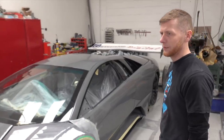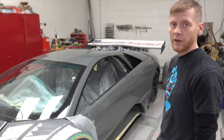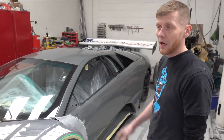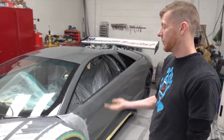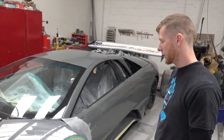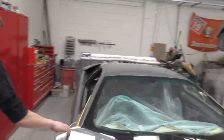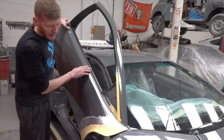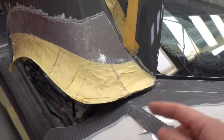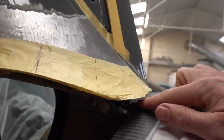It's been tricky, but Craig worked out most of the basics back to the original idea of moving the hinge. He got the positioning close, but the pivot point was still too far back towards the door. So we moved it forward two and a half inches and recessed the hinge up into the door further. That now allows the doors to hinge over the top of the wing like the original panels did. You can probably see there how much we would have had to chop off if we'd left it in the original position.